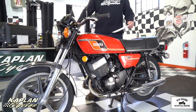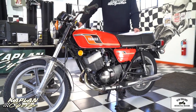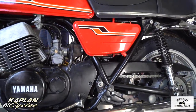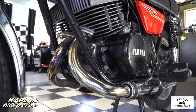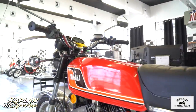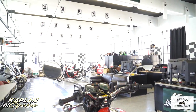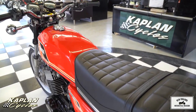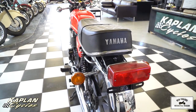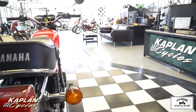Who did all this work? None other than our premier world-class ATEC, Mark Olson, who does frame-off restorations on bikes. He did all the mechanical work — a true professional who's been working on two-stroke bikes for 40 years, done right in-house here by a licensed dealership. Mark then drained the oil tank, blew off the oil supply line from tank to pump, filled it with new oil, and bled the pump — something a backyard mechanic might forget to do, risking running the engine dry of oil. We also drained and filled the transmission gearwell and replaced the drain bolt gasket.